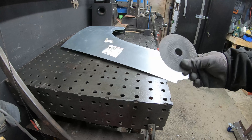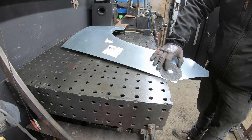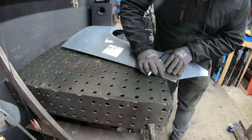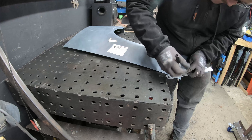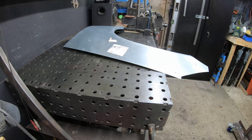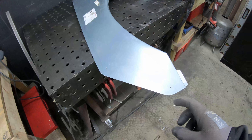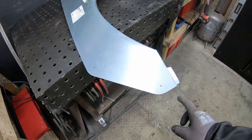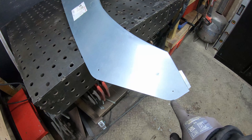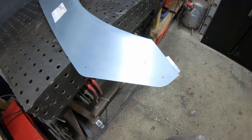With the replacement panel, I'll use a cutting disc to round off these corners, then trim with tin snips. The reason we put a radius on is that if you've got a sharp corner, when you weld from the two points toward that corner point, it creates a weird pull when the weld shrinks.